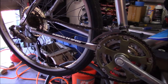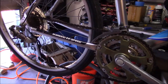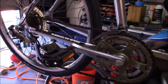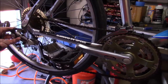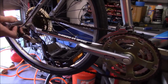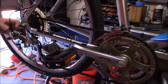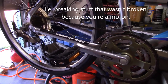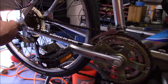Now what we need to do is take the chain off. Sometimes there's a master link, but I don't think there is one on this one because I believe this is the original chain. So the first thing we're going to have to do is take the wheel off. Where you have a cable in the way, see if there's anything you can do to move it out of the way — you don't want to mess it up. Don't push down on a cable to get around a nut; just move it out of the way. Little things like that keep you from having to replace stuff, meaning breaking something that wasn't broken and then having to find the parts. It's not always easy to find parts.